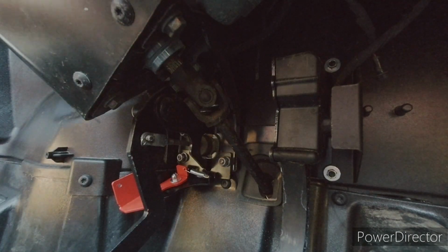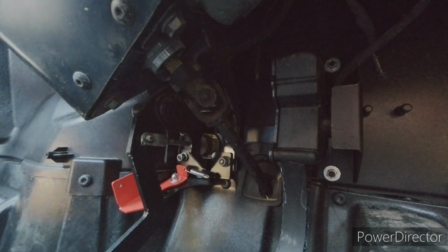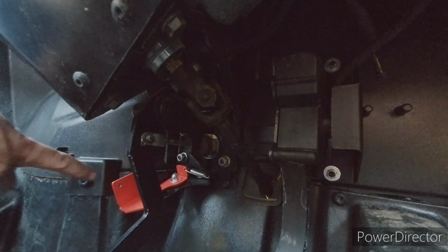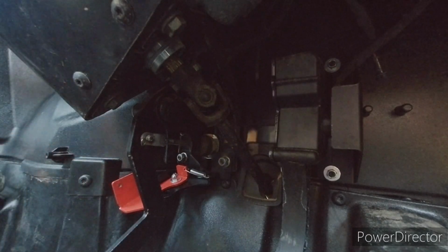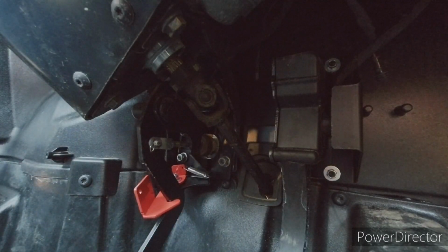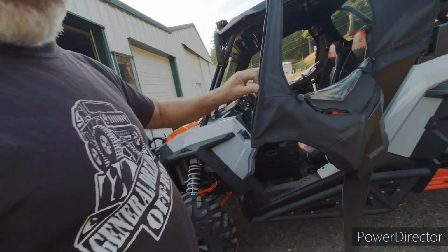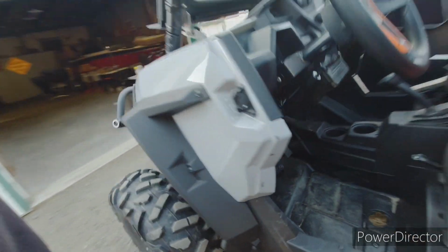Let's see if my feet can get in there and do it. Get this thing over there and move that out of the seat. Get in here, and there's not as much room in here as the General because you got this tire well right here. I got room. I can get my foot right on the side of that. But oh yeah, there we go. So now the brakes are set, which just being parked where I was. I don't know if you heard that. That was pulling it out of park. Machine couldn't roll because the brakes are on, but pretty quick and simple upgrade that'll give you a lot more life out of your transmission. Got our spring brake thingy in there, which we just went over. So the spring brake thingy's in there. Now we got a parking brake.